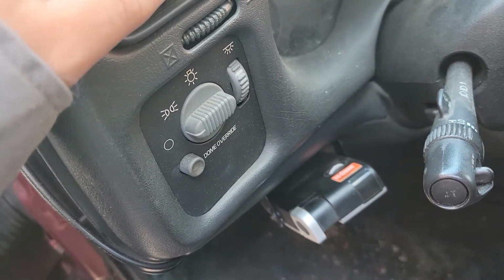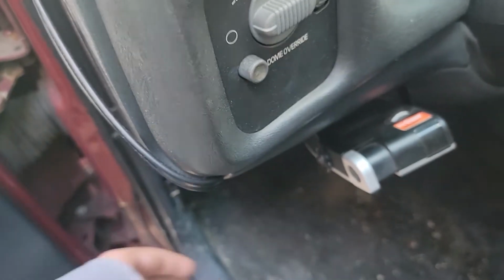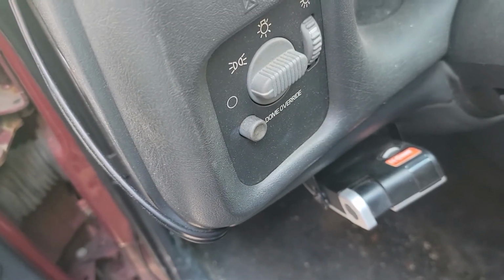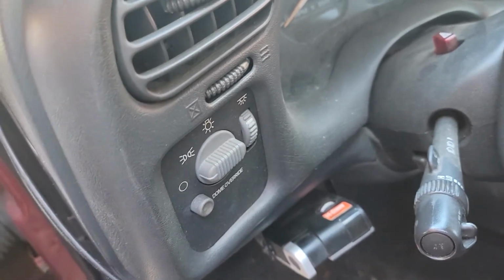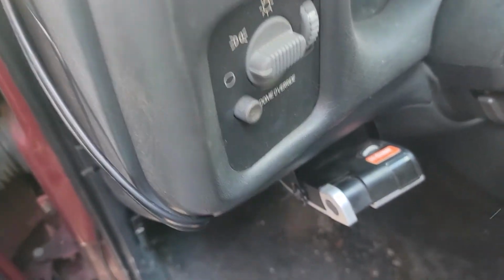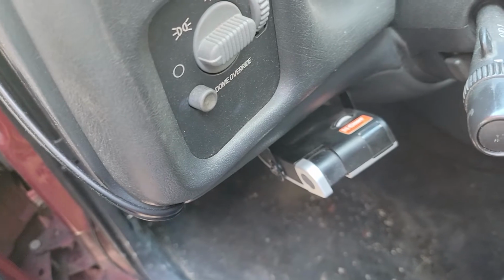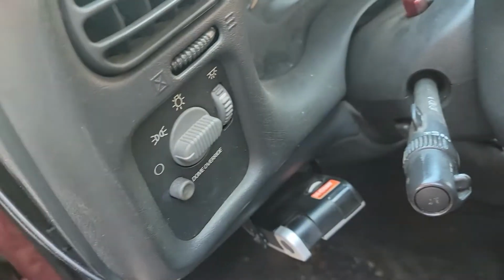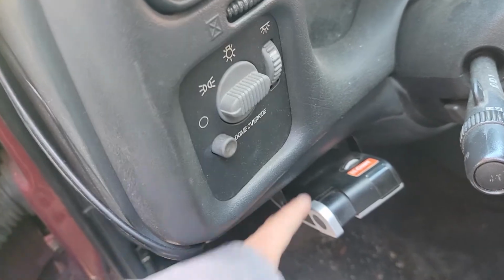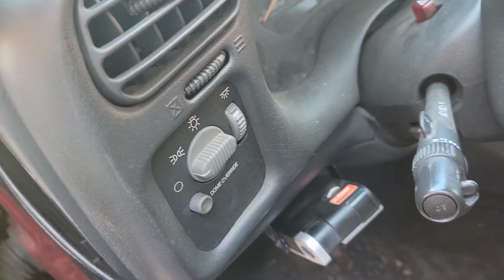Now, if you have a vehicle that has a tow prep package and a plug, which is usually underneath the driver's side, either in the kick panel or somewhere under the dash. I think some might be by the battery, in that area. But on this age of vehicles, it's usually in the passenger compartment, driver's foot area, from what I understand. But anyway, if you have those, you can get that plug. So the two little pigtails that you bought, you can just wire those together. It's kind of like installing a head unit, and then plug that into your vehicle. And then from there, usually all you'll have to do is connect a power wire that's usually tucked up somewhere, and then you'll be good.